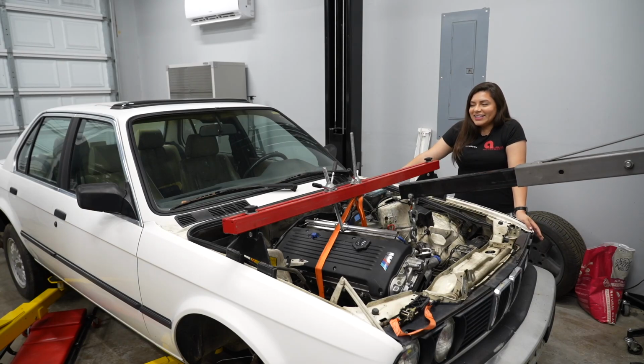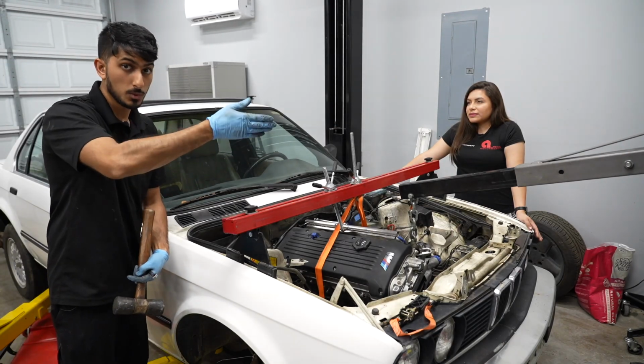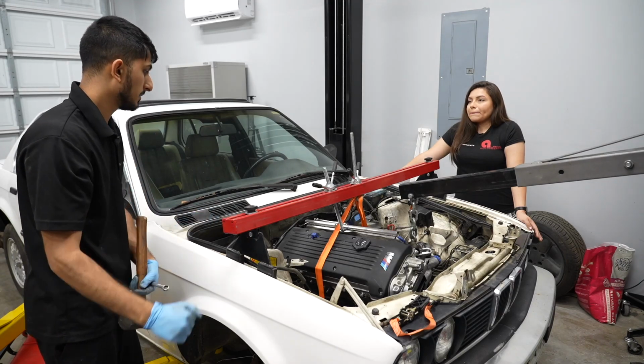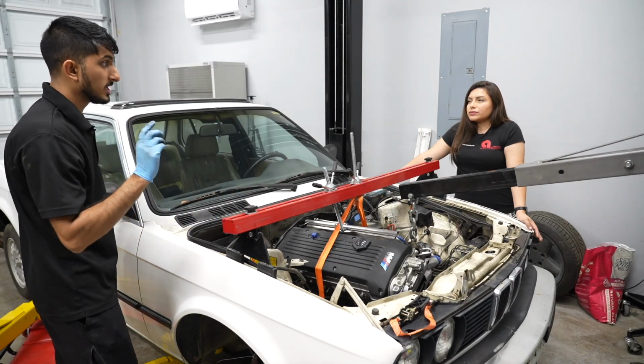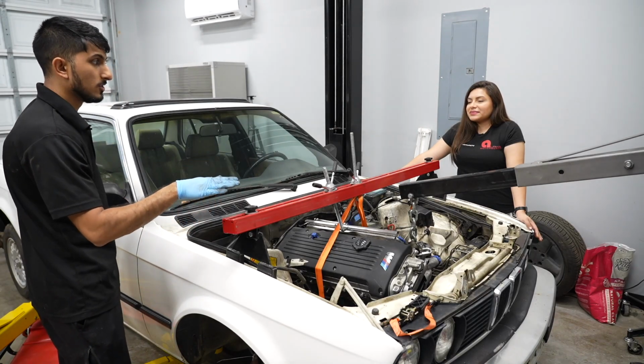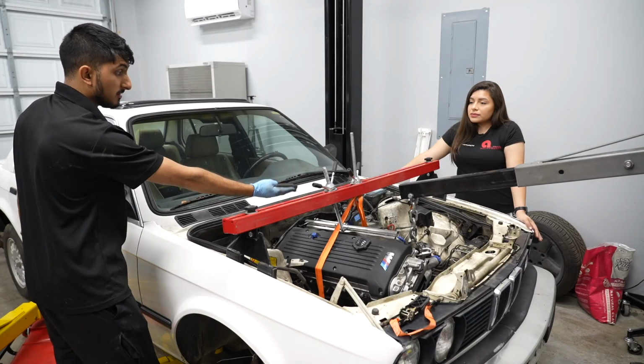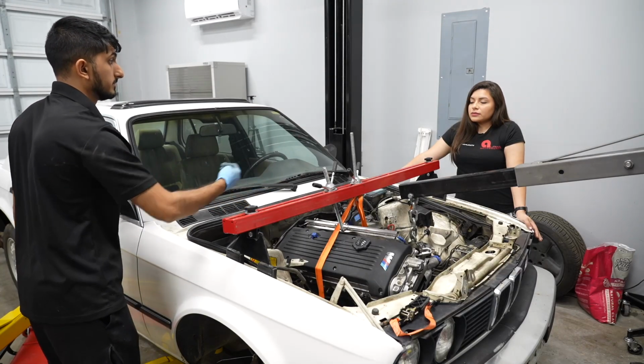Make it badass. Well, there are actually some cars that have straps that go around the engine mounts, especially the cars that are super torquey. Because what happens if an engine is super torquey is the engine's gonna twist whenever you really mash on the gas pedal. So they have those limiting straps just in case that one time a mount starts tearing and you didn't notice, the whole engine doesn't just flop up. So this is not a creative solution, this is a real solution.